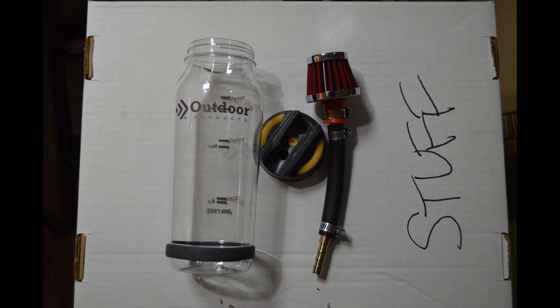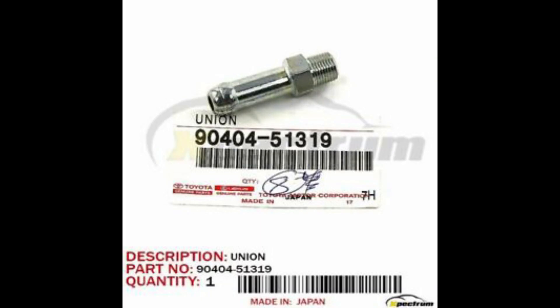It's a pretty simple build. If you just look at the photos I've provided, you'll really get the idea. The barb threads into the axle on the right-hand side of the pumpkin, if you're looking at it from the rear of the truck — obviously the easiest spot to work from. Just unscrew the old one with a wrench. For the new one, put a couple of wraps of Teflon tape around the threads. Note that this fitting is not made out of steel — it's either aluminum or brass, and easy to strip, so do not go gorilla on tightening it down. Put it in finger-tight and then give it a quarter to half a turn past that, just until it feels firmly seated. That's enough, because once the hose is on and the hose clamp is tightened, there's no way for that fitting to back itself out. Just enough to create a seal and make sure it stays in place is plenty. Don't go crazy on it — you'll strip it, and then you'll have a really big problem.